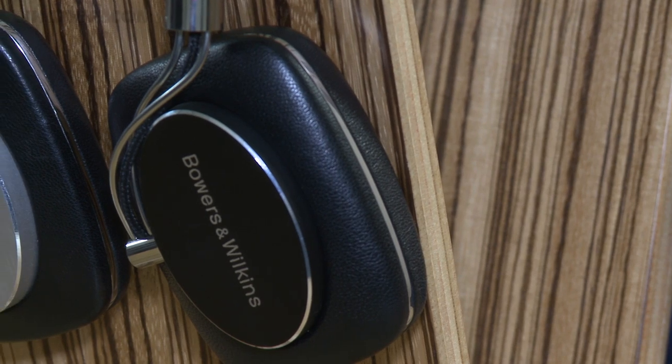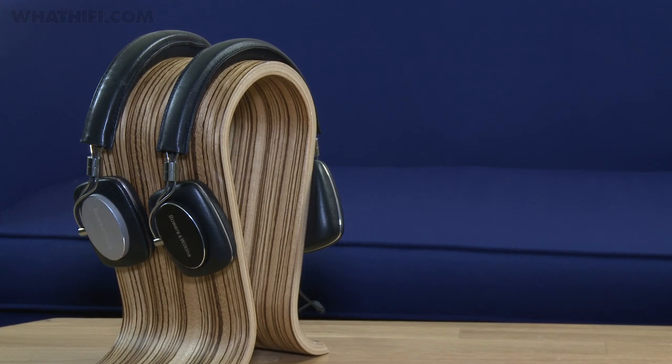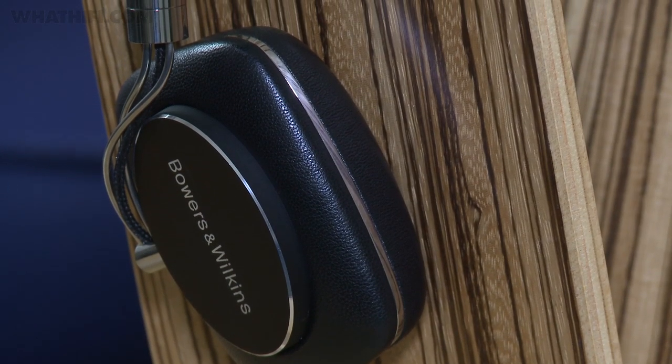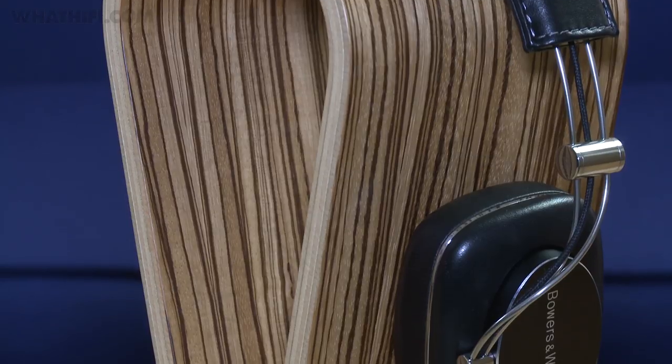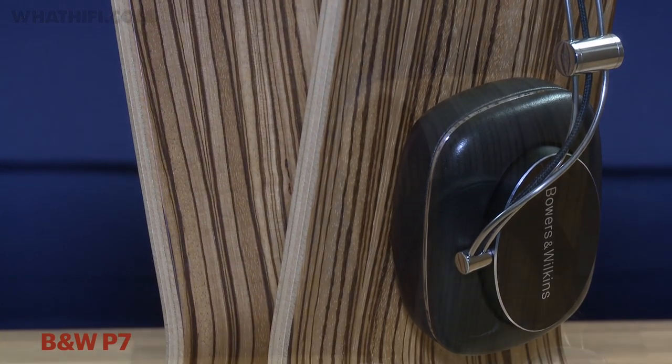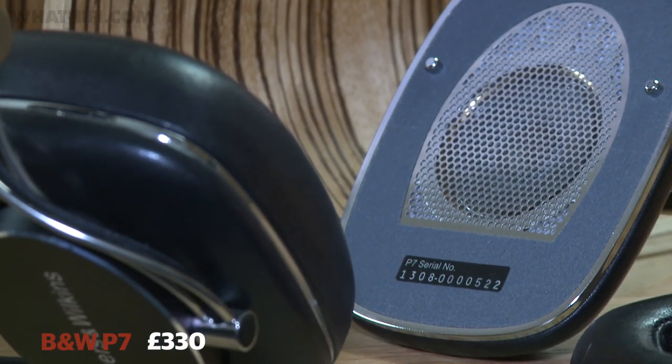Back to the headphones themselves. As we mentioned, not much has changed in the way of physical appearance — they're the same size, the same weight. What's happened is a lot of the changes have actually gone on inside. For example, the drivers inside have been developed from the technology of the P7s, their award-winning big brothers. This basically means the drivers have got a suspended diaphragm — something we see more often in regular speaker design than in headphones. Every internal component has been altered, including the speaker plate and the ear cup enclosure, all of which B&W says will enhance bass, decrease resonance, and create the purest, most open sound possible.